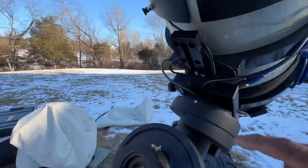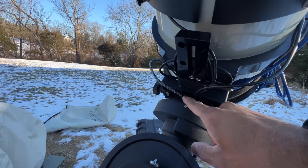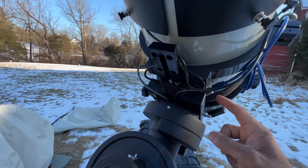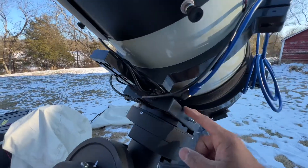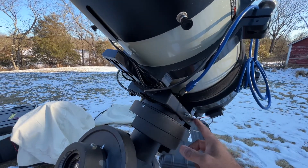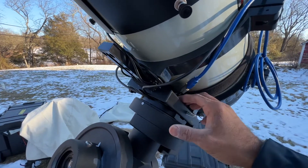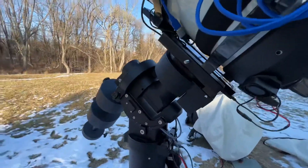If you're using a V-style like I am, you'll notice that there is a gap in the front of your deck plate where you can push out or fish down two cables. You will have to remove your deck plate — there's four bolts there. Loosen them up and pull them out gently, because there are cables connecting your USB hub assembly in the back there, so just be gentle with it. Just lift it and fish your cables out through the back.